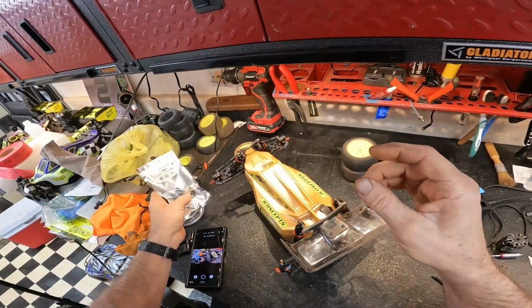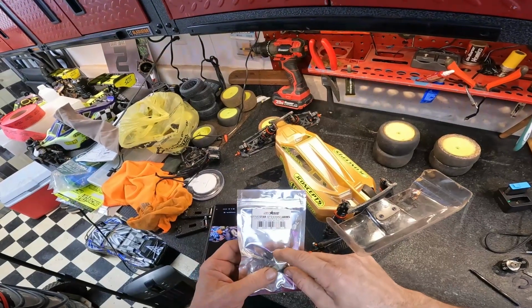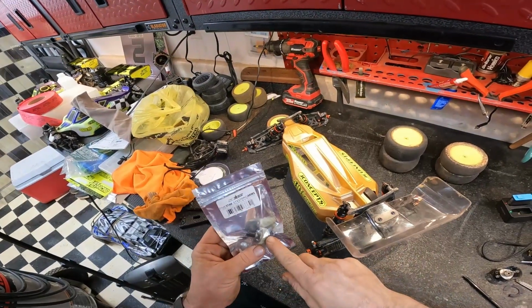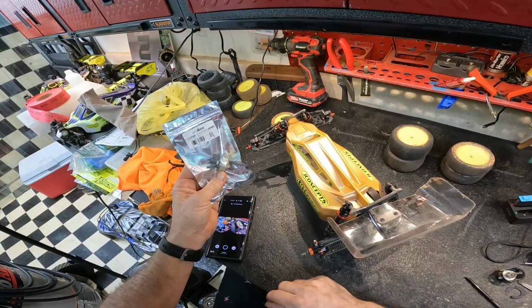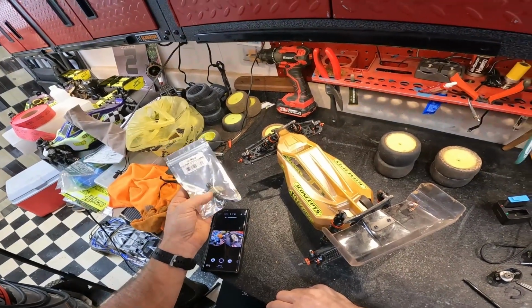Some people have been having problems with the outdrive popping out, so I bought the shims that people are suggesting to do that, but I felt too much resistance in it, and I put it back. I didn't like it. It had a little friction in there, kind of in a bind. So I took it back out, and it lasted all day until the end.